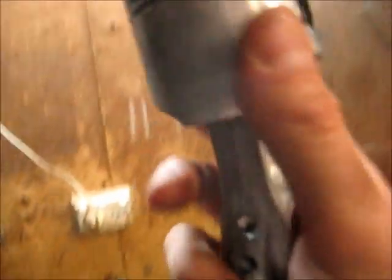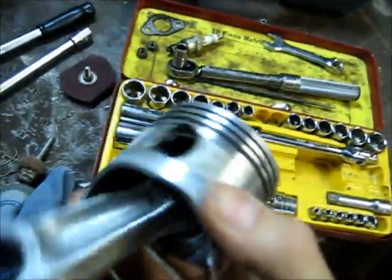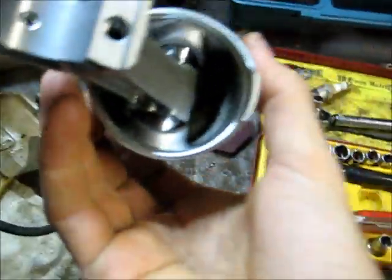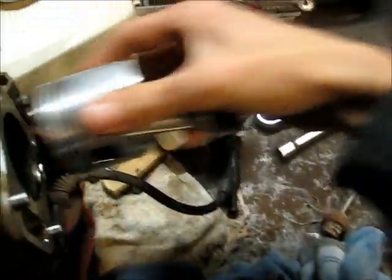On the piston there, I cleaned out these little oil journal holes. Just blast compressed air through them. They go through there to the back of the crown. Oil goes through there, where it's splattered by that little slinger, goes up through there and comes out those holes to form a glaze of oil inside that cylinder.